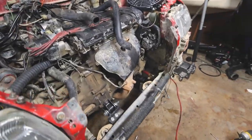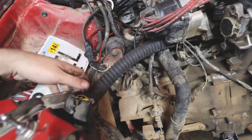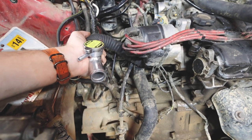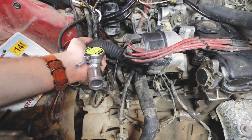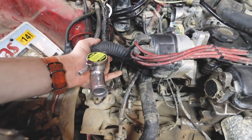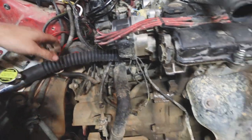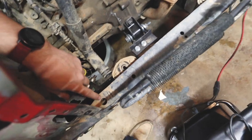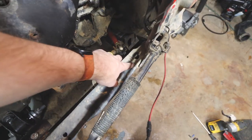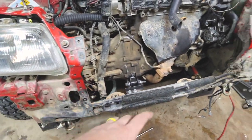Alright, I got the radiator back out and I have a theory. I push this up here with this flex hose — it's got enough rigidity that it'll hold it up and it will be the highest point. If not, I'll build some brackets to hold it in place. What I've got to do now is open up this hole a little bit, drill a hole here to act as a mount, and then use the bolt holes up here to mount the top of it.